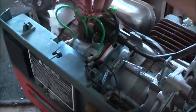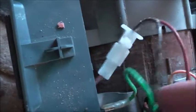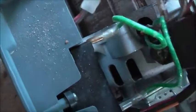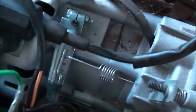For this video I could put it up by saying there's a matching three-phase motor inside this. That's the stator that generates power, depending on how it's wired. It's got two wires to the capacitor and these are your two outputs for single phase — single phase 240 volts, active and neutral. This is like an excited capacitor, a power factor correction. I might make a little fuel tank and shroud for it, do some more testing, and add more fuel so I can make a decent mix and run it properly.